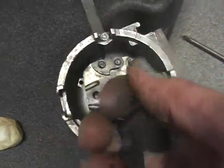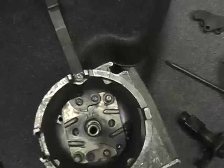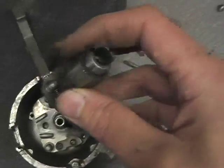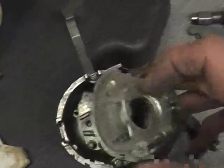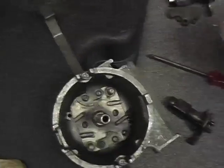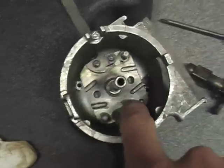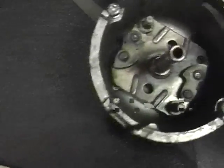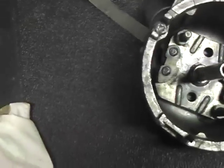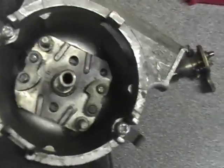The weights are of course quite different so we can get rid of those. The springs on the six-sided cam are also for a different engine entirely. I'm not going to use that base plate because it's metric, but I'm pretty sure that this is exactly the same as the Morris Minor inside. So that's going to be my new distributor once I've transferred the gubbins across. I hope this has been useful for you.